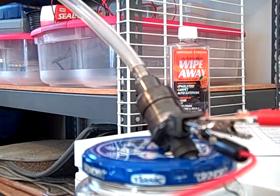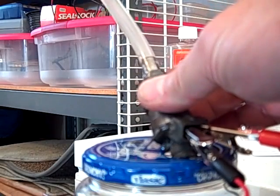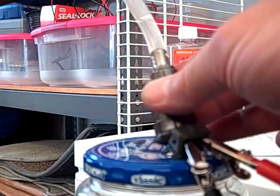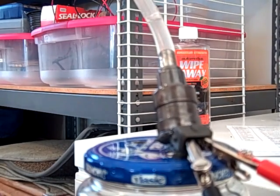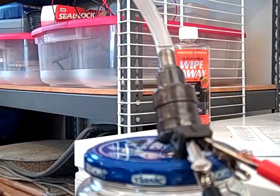To back flush the injector, I did exactly the opposite. I slipped the 5/16 hose over the barrel around the jet, being careful not to hit the tip. I fill a little bit of solvent in there again, and I'm going to do exactly the same thing — pulse that injector. You can see the air coming out, so I'm going to squeeze the bottle just a little bit to put a little bit of air in and let it run backwards through the tube and into the jar.